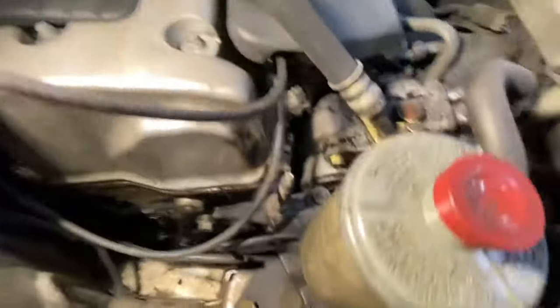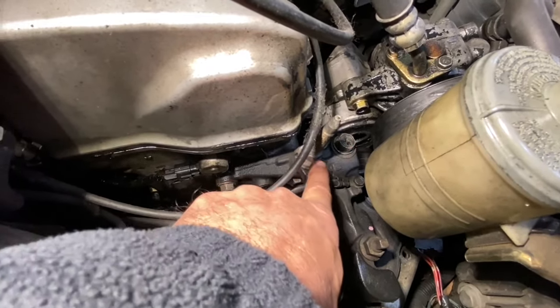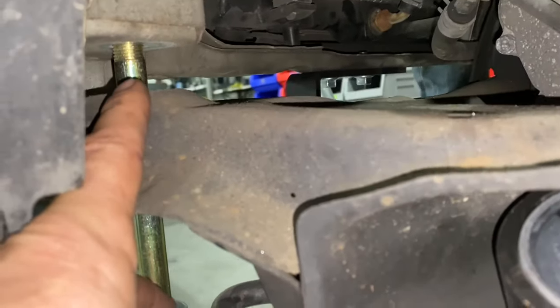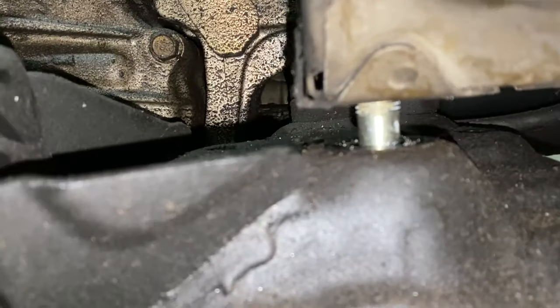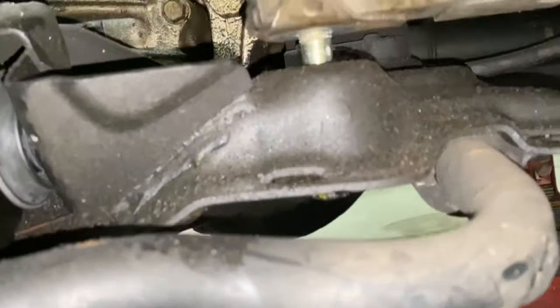Basically all you have to do is remove this nut here and take this bolt out — it's going to get replaced. Once you take that nut all the way off, you'll be able to drop the motor down and then slide this spacer over top of the stud, then simply bolt this bracket back in place. There'll be a spacer right in between this bracket. Slide the spacer into that gap, then run your bolt back up through and tighten it all up. Same thing in the back — create that little bit of a gap, put your spacer in right between the bolt and the body, then put your new bolt in.